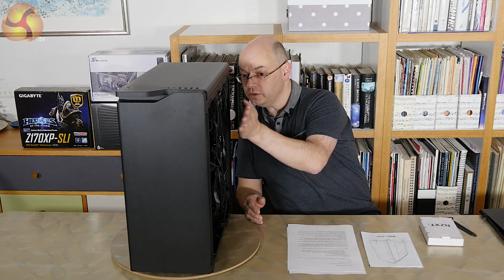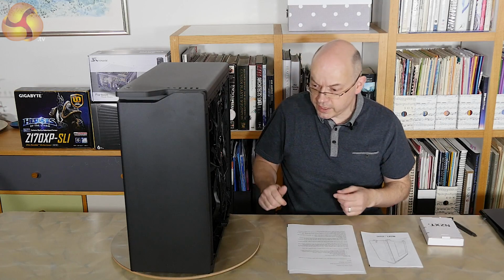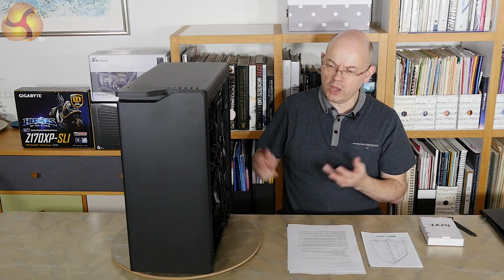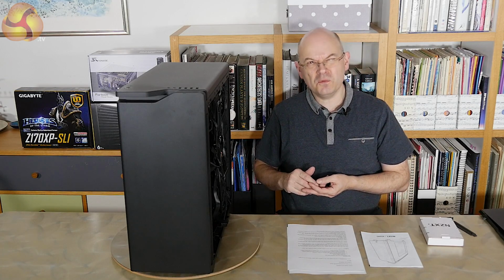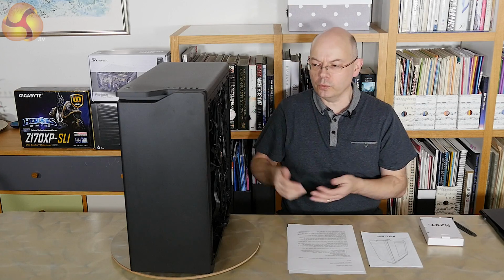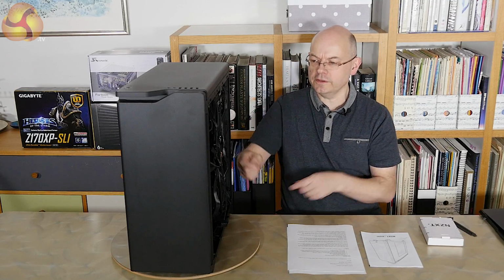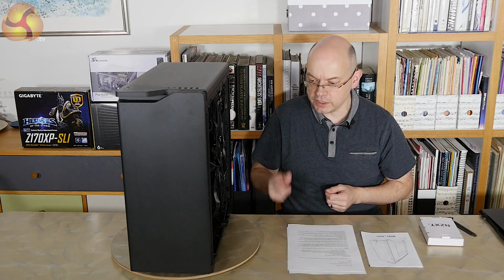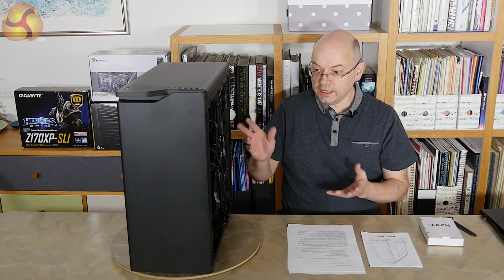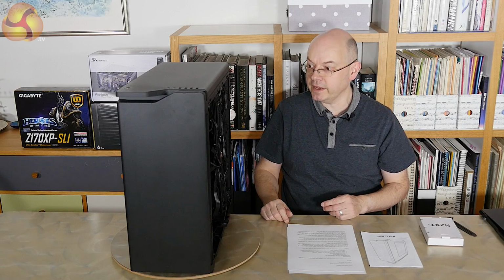So what it's saying to me is, I mean, you can see by eye, it's pretty much flush. There is not a lot of space. You add on the thickness of that material and you're going to get interference, which suggests someone hasn't really thought it through too well. That's a crying shame, because cosmetically this case is superb. The structure of every NZXT case I've seen in recent times, there are sometimes some niggles about it could be a little bit taller or some such, but the idea that you whack in a piece of hardware on the back and then you put in some foam and you don't think, oh, well, that's going this way, that's going that way, we now have negative clearance. Not so clever. Plus, of course, the foam is a telltale. It shows that there's something going on. So in this instance, it would be handy if we had an extra 5 or 10 mil of clearance, because clearly something has to give.